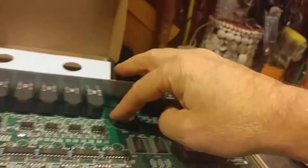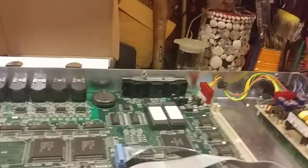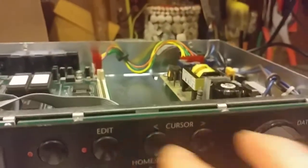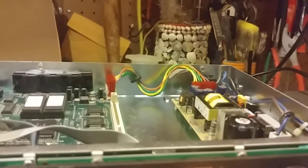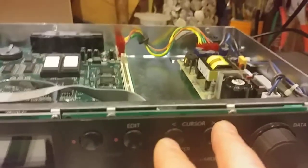I'm going to show you how to do that — then reset the unit and reinitialize it to solve that problem. Right now I'm going to turn it back on in diagnostic mode. The way you do that is you hold down both cursor buttons at once while you're powering it on. You can't just release them right away; you'll hear some clicking going on inside the unit as it's powering up, so you've got to give it a little chance.